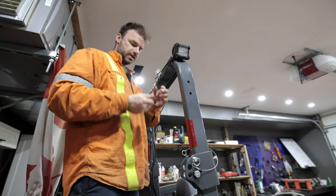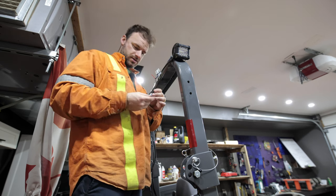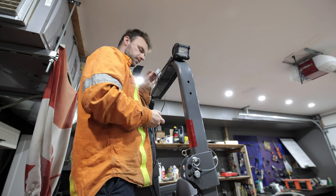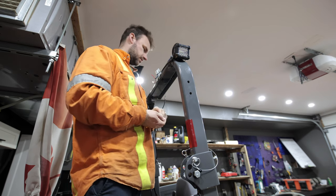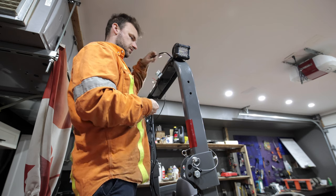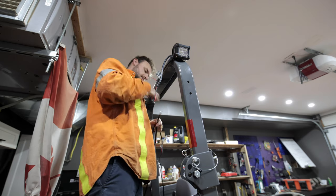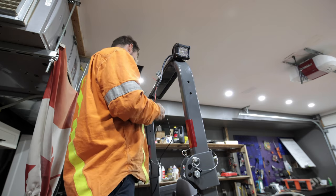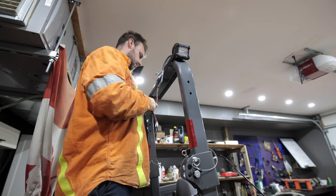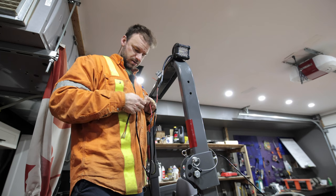My kit came with little 12-volt connectors for these little baby wires. I just realized I forgot cable strippers, so I don't really want to cut any wire. I'm going to end up with a little bundle of stuff up here, which I'm okay with — it's kind of hidden behind the rack. I'm going for ease of use. So we've got one, two, three lights — one's kind of by itself, this big guy. These are quick connects: one side's got a flat paddle and the other side has a curled little thing that accepts the paddle inside it. You just insert the wire and squeeze with your pliers — use the inside of the pliers for good leverage to get a tight squeeze.